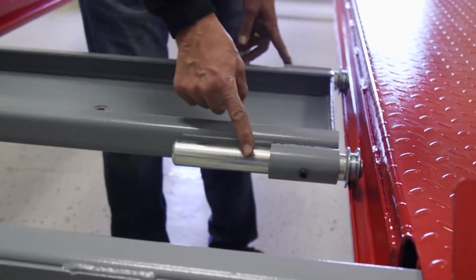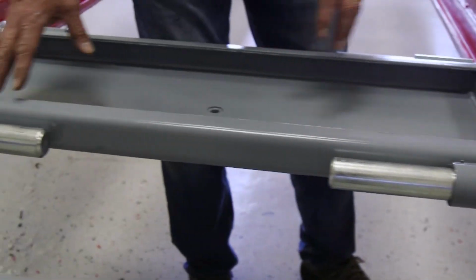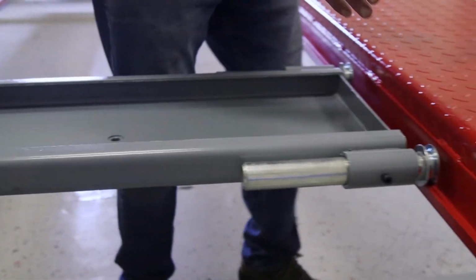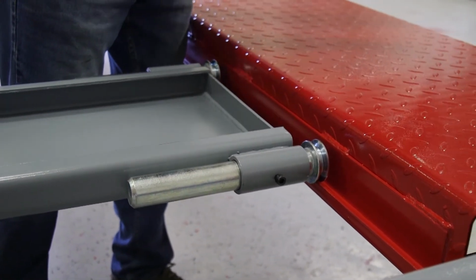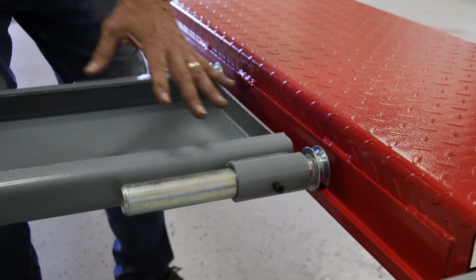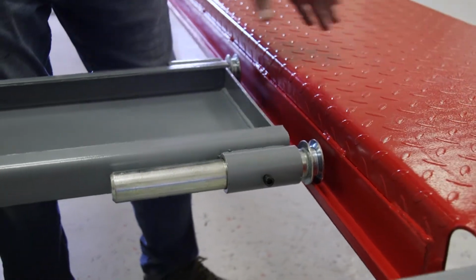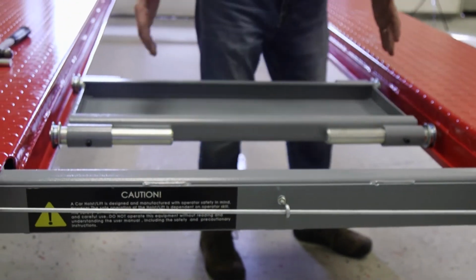Now, with this also being adjustable, as you see, I've left this one so it floats. This is an XLT. The non-power cylinder track can be moved out 4 inches. So that's neat that I can just loosen these set screws and this will adjust out to that wider setting, and it fits to the wide setting on the XLT or the narrow setting.